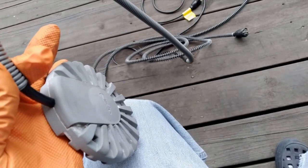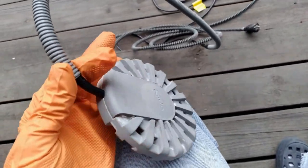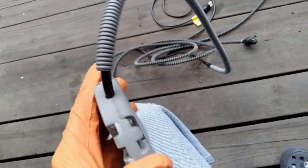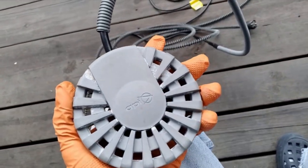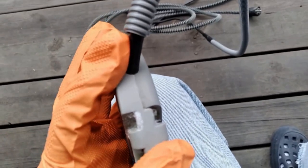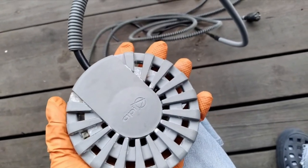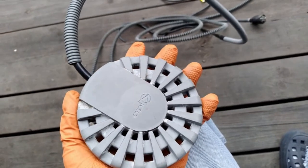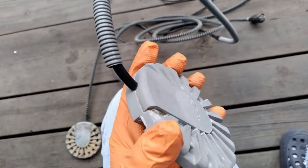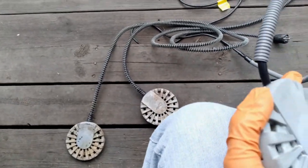This one is quite new — I just bought it last year. I think I may have another one around here I'm going to have to find and see if I can fix it. I suspected that the reason these were failing is right there where that cord goes into the housing — water is going in around that cord and shorting these things out, making them blow fuses. All three of them were blowing fuses at the end of the season last year.